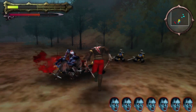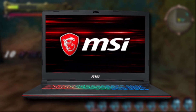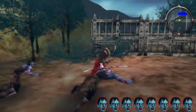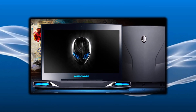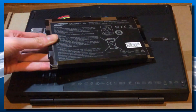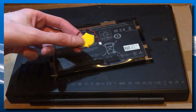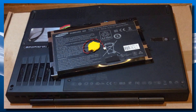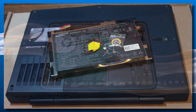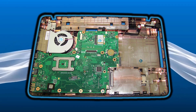Now I'm going to show you guys how to do this on laptops. It's pretty much the same thing but a little bit more complicated — laptops are harder to take apart and also differ a lot from desktop computers. For this video's demonstration I will be using a very old Alienware computer, an Alienware M11x R3 laptop. What you can see right here is a standard laptop battery — this is not the CMOS battery. The CMOS battery is this tiny battery with yellow plastic around it. Some laptop CMOS batteries might look different and may require soldering.